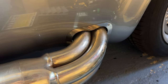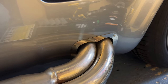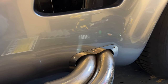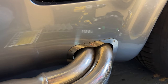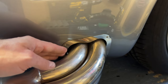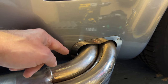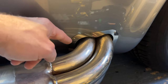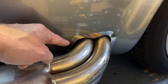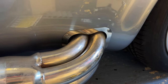Moving on to the exhaust on the driver's side - no real dramas, goes in and slides on fine. However, you may find it more difficult once you've secured the escutcheon because that can limit the amount of movement you have left and right. It might be worth putting the escutcheon on after - fit the exhaust with the escutcheon just hanging here, mark the holes, then rivet it up. My hand rivet gun could get into everything just fine. I did fit the top two rivets first thinking there might be limited access, then found it a little difficult to put the exhaust on - so I'm mentioning that.